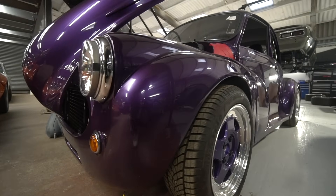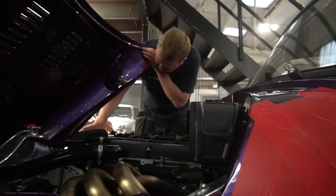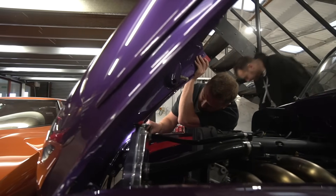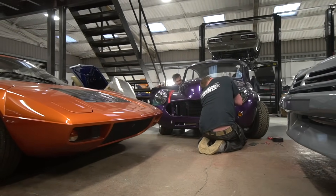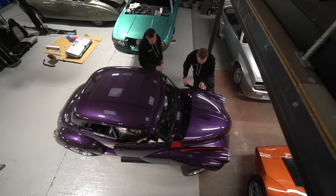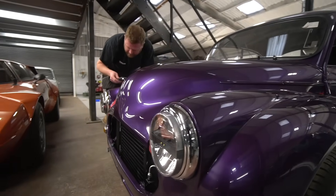On the Morris, Adam and I were working on the bonnet - it's been a bit of a pain to get perfect. Stu had it very close when he was doing the metalwork, but the latching was being temperamental. It's quite complicated to get the alignment right. Once we'd got the hang of that it was latching, but one side kept popping out. We've done some changes to the original latch pins - they're VW pins with quite a chamfer on the back, making it possible for the slider plate to ramp up the chamfer and pop back out. So we've machined those chamfers out and done a slight edit on the latch plates so they engage slightly further.